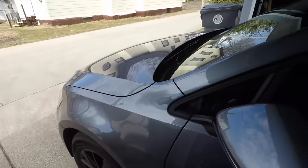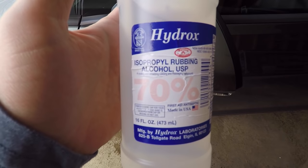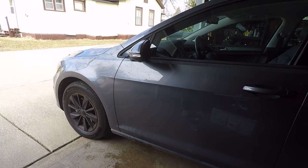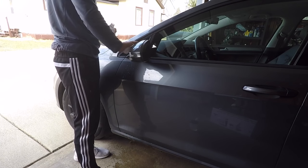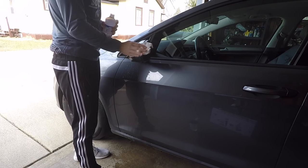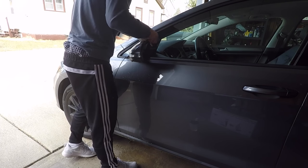I washed the car yesterday so it's in pretty good shape. What you're going to want to do right before you get into the wrap is take some isopropyl 70% and rub it on the mirror just to make sure you get rid of any residue. Put a little bit on a wipe — not too much — and make sure you get the edges really good too. You want the vinyl to stick really well.